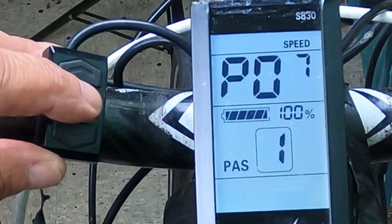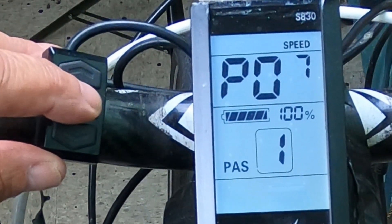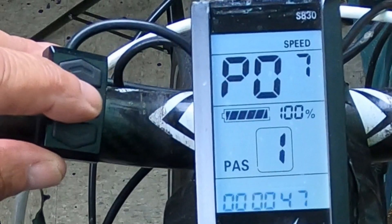P7 is really important — the magnet steel number for the speed test range. It's set by default to 100, but for this particular kit you want to set it to 47. It's really important, otherwise your kit won't run correctly.